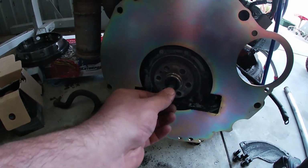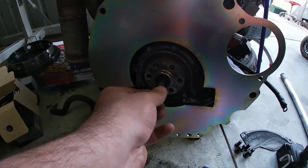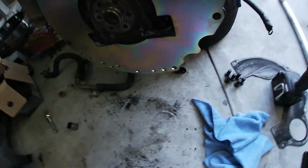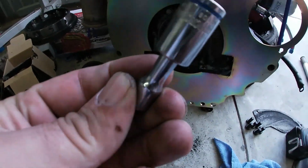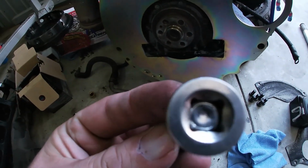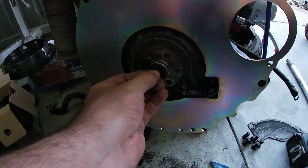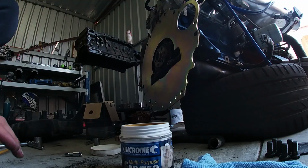Alright, we're gonna scratch the bolt idea. The one I got has a little bit of movement between the bush and the bolt, so I reckon the grease is just gonna splat out. But I've seen my 11mm socket with the extension in where the nut would usually go, so it doesn't have much room for the grease to go. Fits perfect in there, so we're gonna try fill it with grease and then whack that in there. Hopefully it does the job.